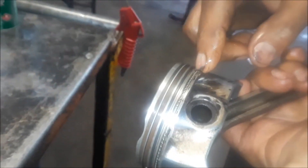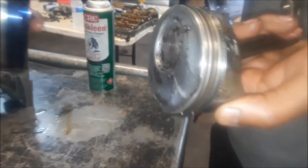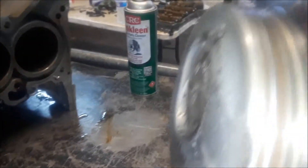Ring, opposite. That's a compression ring, and these are two oil rings. The oil ring always has to be opposite. So it didn't hurt the cylinders at all? It just only hurt the rings, right? Yeah.